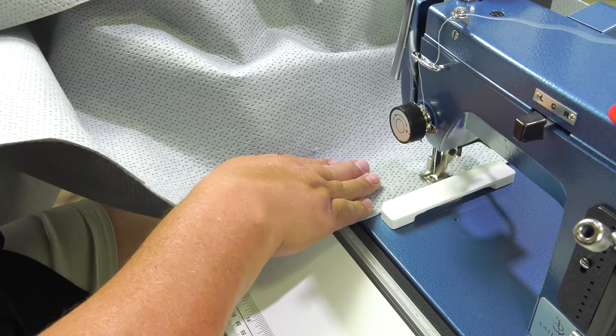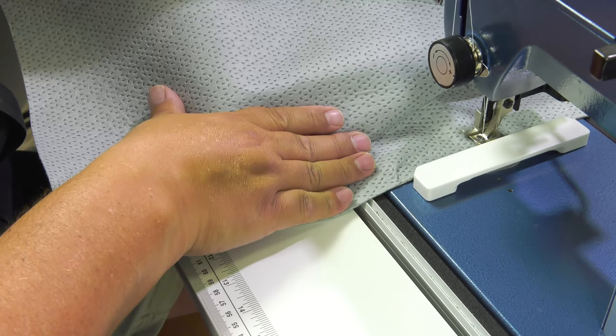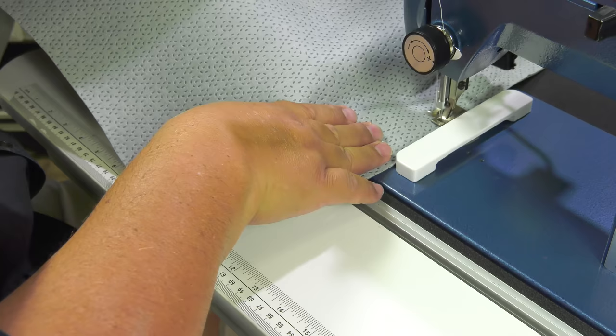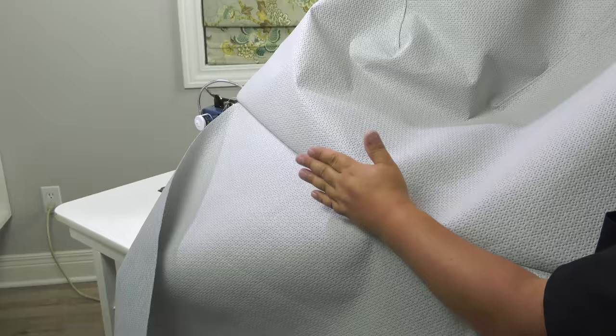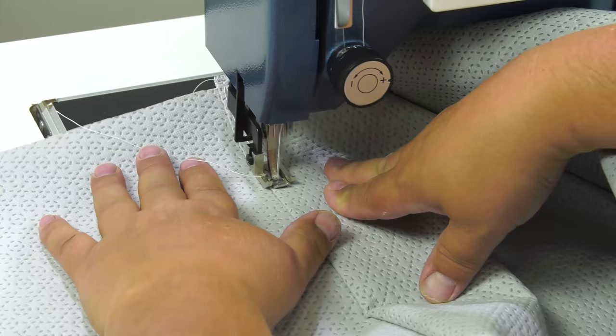The seam could just be one stitch — that's the quick way to make a cover. But creating a top stitch, or semi-flat felled seam, is the more professional way. The passenger seat is higher than the driver's seat, so we want water to run off accordingly — our tail on the underside will go towards the right of this cover. Now we create our top stitch.